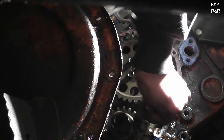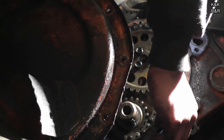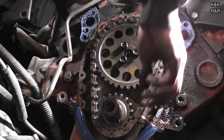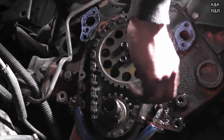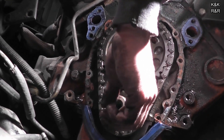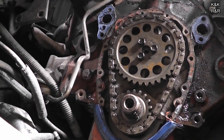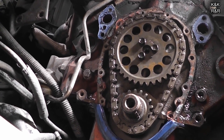Why build a beautiful motor and put a single roller? We'll get the cover out of the way. Okay, now you can play with the chain. There's our four degrees. This thing was still beating Subarus. Do you want to put the balancer on and rotate it and see? We can time it — we got to time it before we tear it apart, that's for sure. It's a Cloyes, so that'll make it easy.